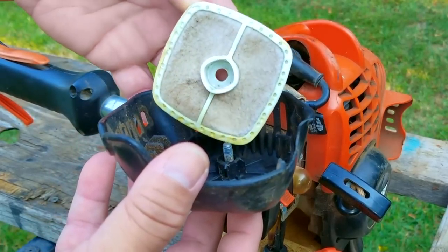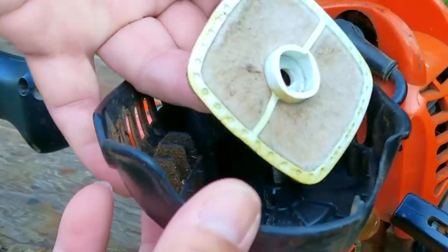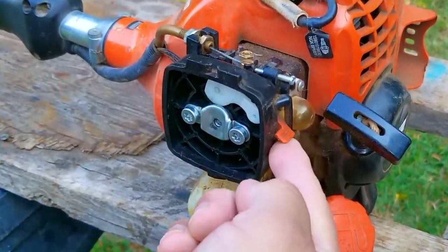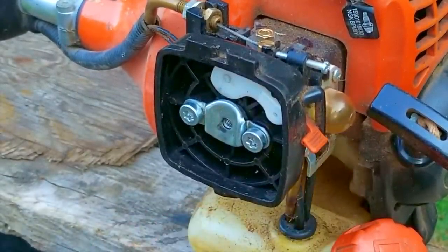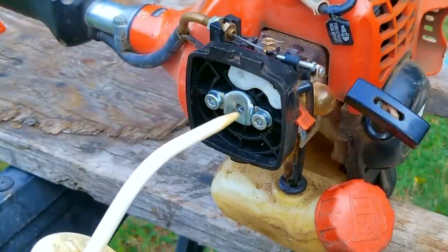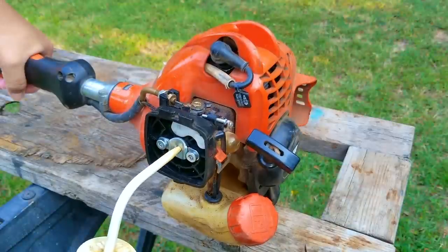The air filter is not wet, which is a good thing, but it has seen better days. There is some fuel on the edge of it, which is kind of strange, but it is not bad enough to keep the engine from starting. Here's where everything gets more interesting — when trying to move the choke lever, I realized there's something keeping it from working. With the air filter out of the air box, it's pretty easy to see what that is: the choke flap looks to be hitting the metal plate the cover attaches to. I've never seen this problem before. I have a theory about what could have happened, but that won't matter unless this trimmer can run, so the first thing I need to do is confirm it will at least start and run for a few seconds after I prime the engine.